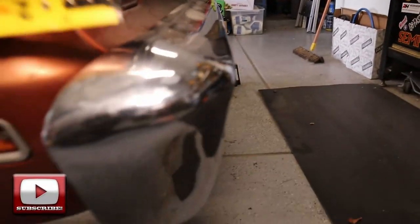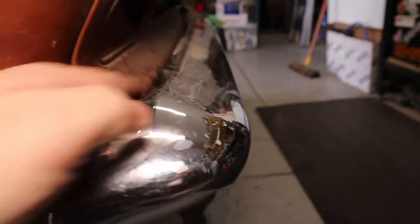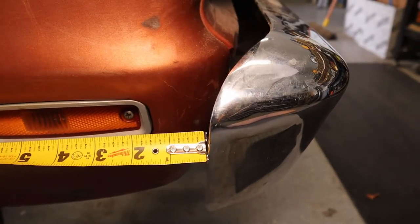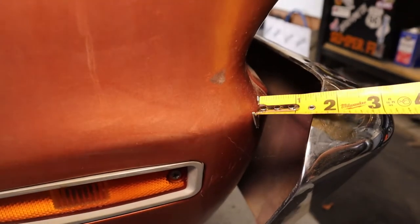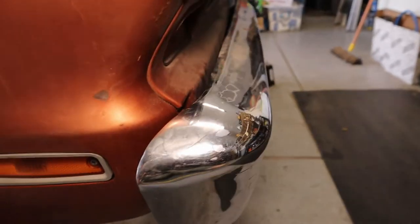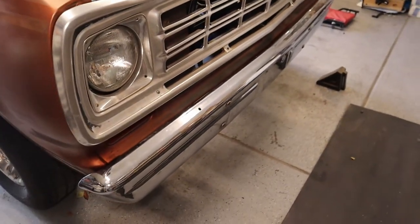With the tape measure here in place, I definitely have room — this should come up and over this part of the body if I just bring the bumper straight back. I don't want to get into the side marker lights, so that gives me an inch and five-eighths there. Looking at this area here it looks like about an inch and a half, so if I plan on maybe an inch and a quarter I think that'll give me just the slightest bit of tuck and really help improve the looks on the front end of the D100. The first obvious step would be to drop the bumper so we can get a closer look at the brackets and determine if I can move them or if I'll need to modify them a bit. Let's get to dropping the bumper.